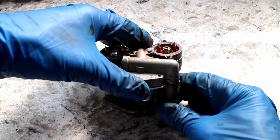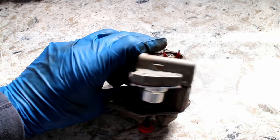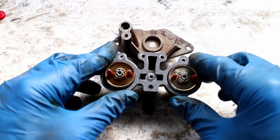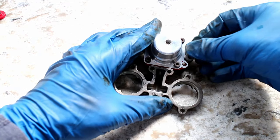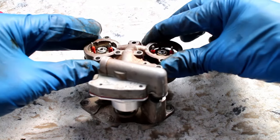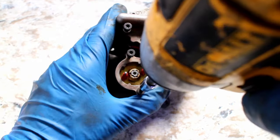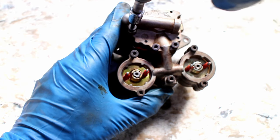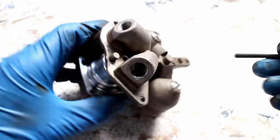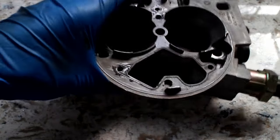Place the injector pod on the unit and see if the adjustable screw fits. Since it fits, move on to installing the injector pod cap with a new gasket — make sure not to forget the little figure-8 gasket. Reinstall the injector pod and Torx bolts, then install the regulator screw. You can adjust the fuel pressure by screwing the red knob up or down. To clear the screw, bend this vacuum line just a little bit.